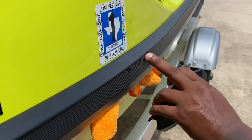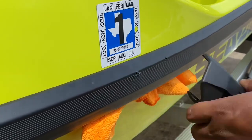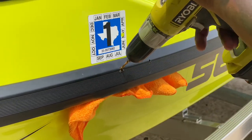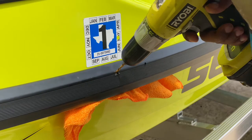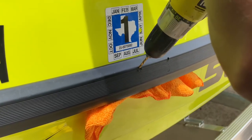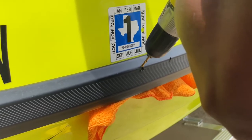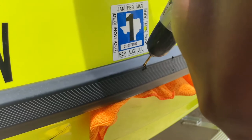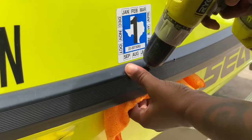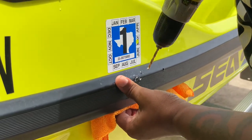You can see your holes going through, so I'll finish drilling them to show you the finished product. This is the point where you make sure your towels are really in there. We're going in at about a 30-degree angle so it's going to come out right on that towel. Lean on your drill, go slow, you'll feel it break through — and it went through, the towel caught it, no problem.